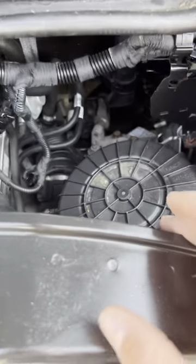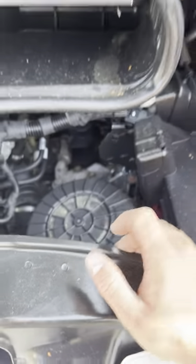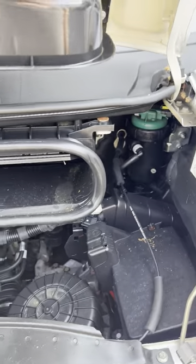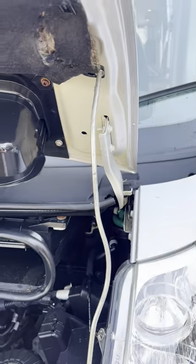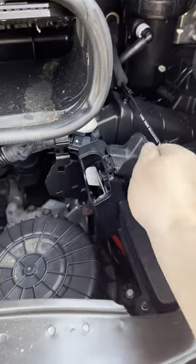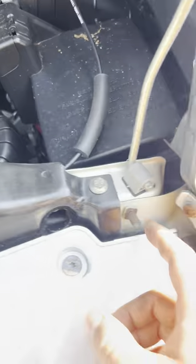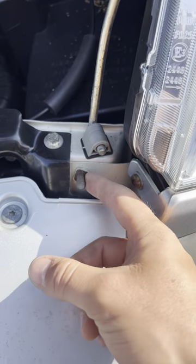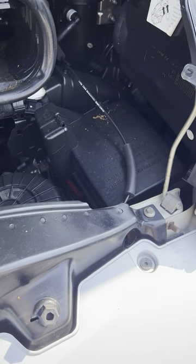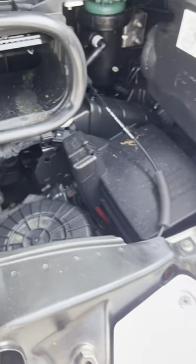On the right hand side we have the air filter sitting inside this box just here, and the fuel filter is just there as well. The engine battery on these particular chassis sits under the floor in the cab just in front of the passenger seat, so you've got a positive terminal just there underneath the little cap and an earthing point or negative terminal just here. That means you can jump start the vehicle from underneath the bonnet if you ever needed to.